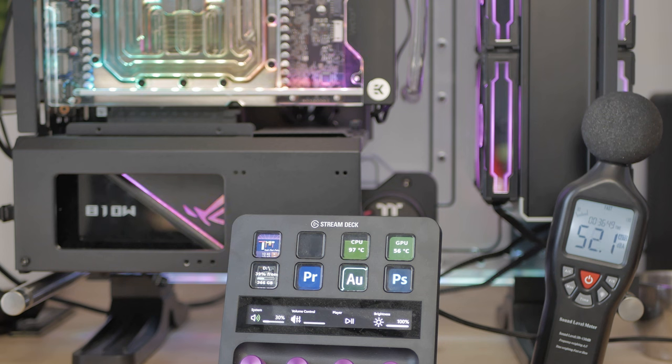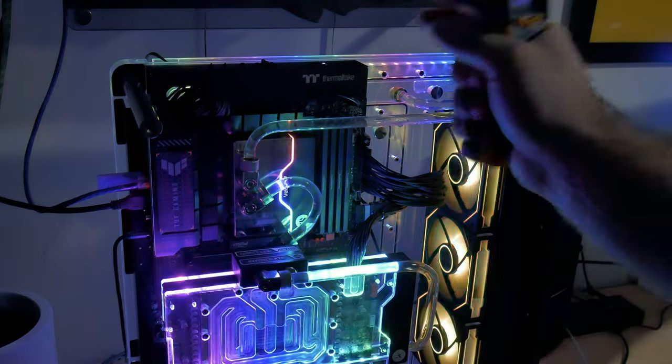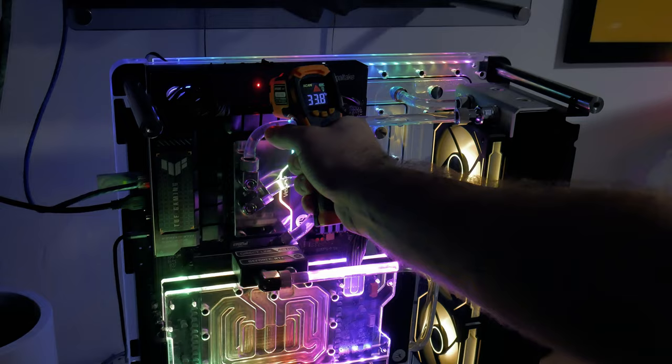The radiator can manage all this, which is even better. One radiator, which is a thick one of course, and six fans. So you know what, that's a lot of, I suppose, cooling. And look, if you are planning on building something similar, I can happily recommend using one large radiator with six fans in a push-pull configuration. It works really, really well.